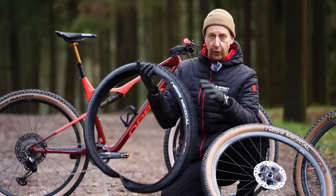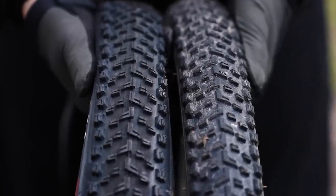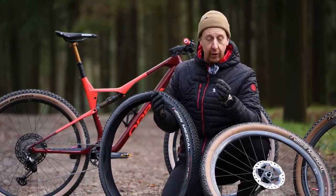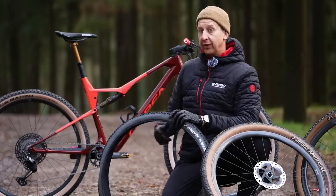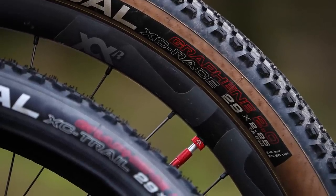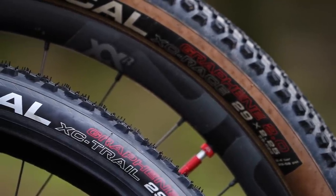These ones are cross country trail tires — they've got the same exact tread, the same size and rubber compound, but the difference is they have sidewall support on them. The sidewall support gives you a little bit of puncture protection and a slightly stronger casing. If you're a heavy rider physically, these will be a better option for you. I actually love the feeling and how supple the skin wall tires can be, so I get around that by using inserts. If you're extremely heavy or riding somewhere quite gnarly, running an insert with a set of tires like this is a really good thing to do without sacrificing your rolling speed.